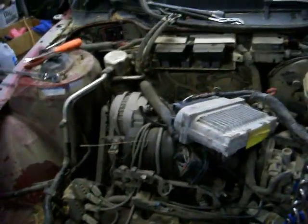I've got pretty much everything off the top disconnected that it needs to be, except for that mount, which I will do once I have the car jacked up and the engine chained to my little hoist. I kind of got lazy and didn't feel like disconnecting the wires up there, so I just took the whole computer and threw it up there. It's good enough, it won't snag on anything. I'm going to leave all the battery cables disconnected because they're tied to the frame and the engine down there, but I've got them disconnected from up there. So now I'm just going to go ahead and jack her up nice and high so I can get underneath, and I'll chain my engine up so it doesn't fall on my head.